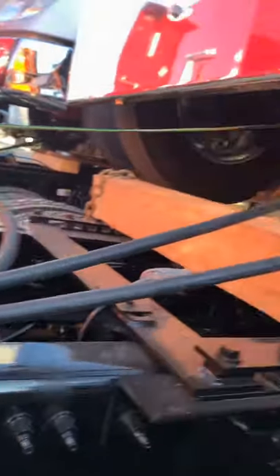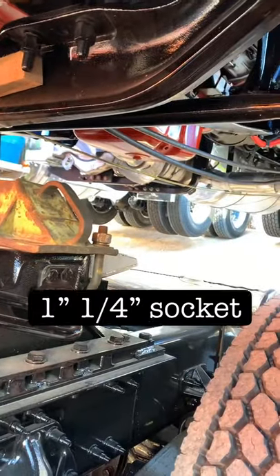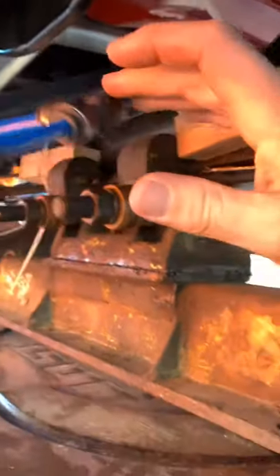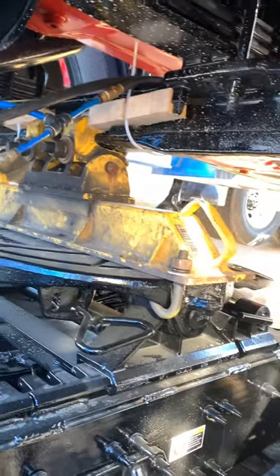Check the wires and make sure everything is zip-tied - no loose wires hanging. Do the same thing on the front, but this one does not have u-bolts. What it has is a saddle attached to the fifth wheel with two bolts on each side, same size one-and-one-fourth inch deep well socket. Then you have your other two sockets up there at one and one-half inch. Make sure the air hoses for your brakes are all connected and that hoses are not hanging down where they can get snagged. Continue back to the third and last saddle - again a fifth wheel saddle, two bolts, one on each side. Check the hoses, make sure everything is connected correctly, no loose wires hanging.